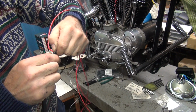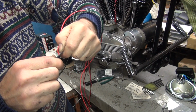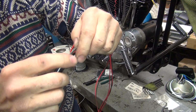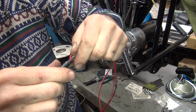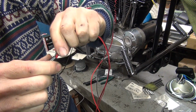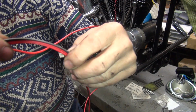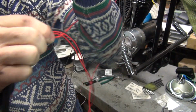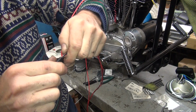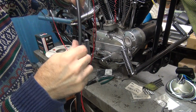It's about a 1/4 inch at a time. It's starting to free up though. It's tight though. If you try to push too much wire, then all it does is fold up on you, put the kink in it, and that kink gets worse as you go in the harness. And see, I'm getting the wires, I keep them flat all the way down so they can go in the same way. So if you have them all twisted up, it just makes them bigger diameter and jam up more.